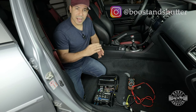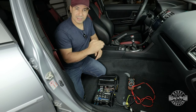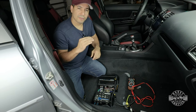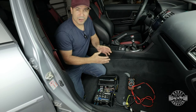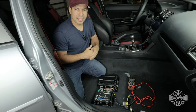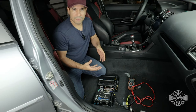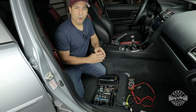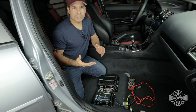The amplifier puts out the power it's supposed to put out cleanly at that level. Whatever your head unit maxes out at in terms of voltage, you can set your amplifier to max out in terms of power at that voltage. So when you build this hypothetical amplifier and head unit you don't have to put a gain dial on the amplifier, because you already set the internal gain — you built that amplifier only for that head unit.